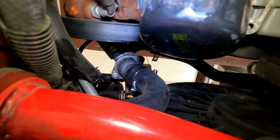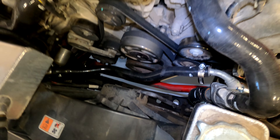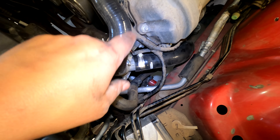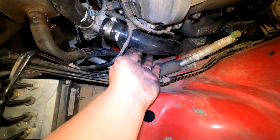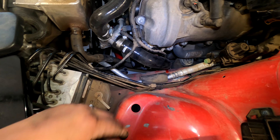So we moved to worm gear style clamps all the way around and tightened everything up. Everything looks good. I made it so you can loosen and tighten all those clamps for the top hoses from the top and you don't have to mess with it from underneath. So this one's in and tight, that one's in and tight. Double check all your connections - all four of these connections I have where you can tighten from the top. You're gonna want to do that too so it's easy in the future.